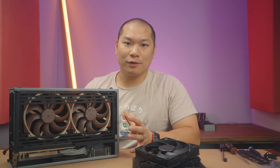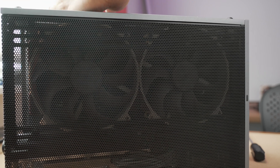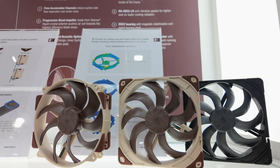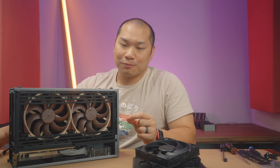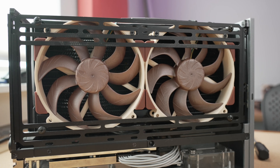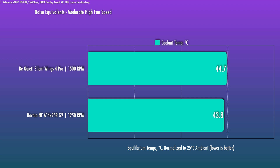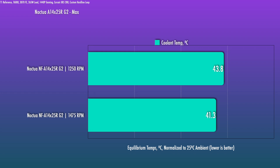With the round A14 G2s, the equivalent noise level came in at 1250 RPM. It's worth noting that with this particular side panel setup, I noticed an increase in noise from being close to the fan blades. The fan blades are spaced very, very close to the outer face of the frame, and unlike the square version, these don't have a transition boundary on the frame — it's more of a hard square edge. So when I do test the square one, I anticipate the noise will be different. I think the noise-equivalent RPM on the square version will be higher. The coolant temp dropped about a degree, and testing at max — roughly 1475 RPM — I saw an even larger improvement for the temps, which is promising if the noise characteristics are better on the square version.